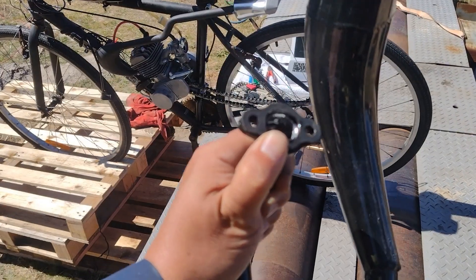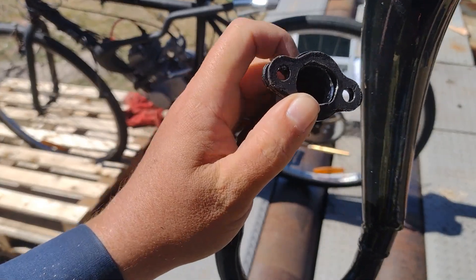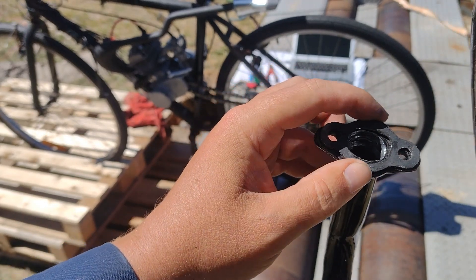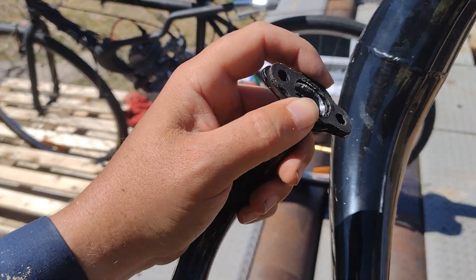While that was cooling down I did some light port matching. The inner diameter of this pipe is actually quite large and the restriction is this flange here. So I've kind of merged that to the gasket as best I can, and the gasket is matched to the cylinder port. So I'll go fit this and we'll see what happens.